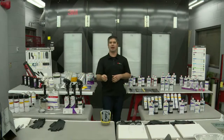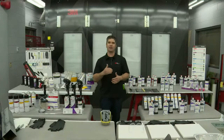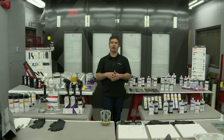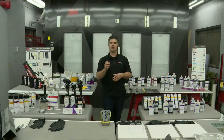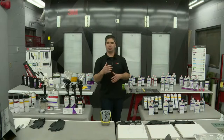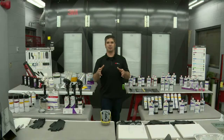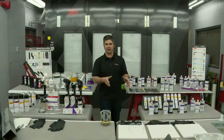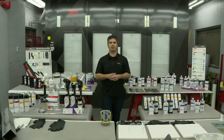But one of the things I want to highlight here, and why I called out that Ford procedure specifically, is that they do require epoxy primer to be applied to any bare aluminum surfaces, with the exception of our Quick Grip product and one other product that is called out in the industry that can be applied to bare aluminum. The OEMs, I think one thing that you've probably heard Sean and I talk a lot about, Jason, I know you guys are passionate about this as well, the OEMs are the experts on how the vehicle is built and should be reconstructed in the event of an accident. Okay, so what they say actually supersedes anything that a product manufacturer would say.